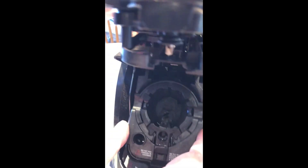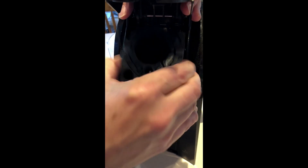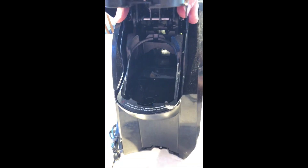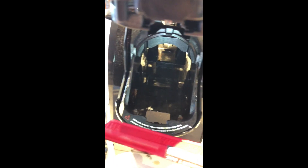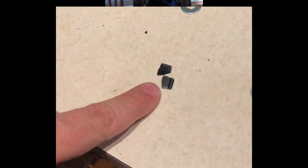To take those two tabs out just squeeze and pull it out — that's your k-cup holder. Then take out the little drip tray. Look back in there from the top or from below, and you can put a paper towel in and rub around to find them. They look like little tiny squares, about that big, and they broke off.